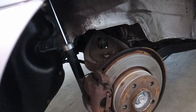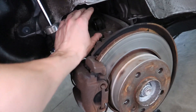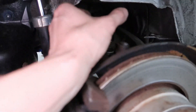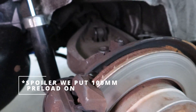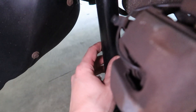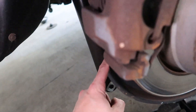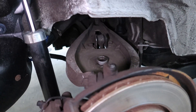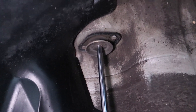Keep in mind, even if I were to jump this car, no one really understands how to set up the shock. But the way it works is: you put your spring in at whatever height you want to set, then you've got to set preload using the shock. You're going to jack this section up until the spring stops moving, and then go another 5mm up to put 5mm of preload on your spring - like you would with a normal coilover setup. Once you're at that height, you spin the new one up so that it lines up. Now the other section we have to do before that is go into the boot and take out those two nuts.